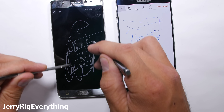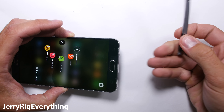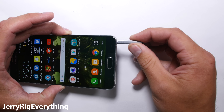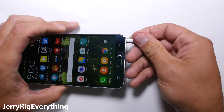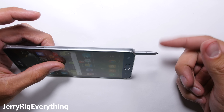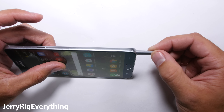With the older Galaxy Note 5, if you were to accidentally stick the S Pen in the phone backwards, it gets stuck permanently and will not come out again without breaking the sensor inside of the phone. Samsung did quietly issue a hardware fix for this about 4 months after launch, but there is no way to know for sure which phones have the fix inside, so it's better off to just not try this. I personally received my Note 5 at launch, and as we can see, it definitely does not have the fix in place.